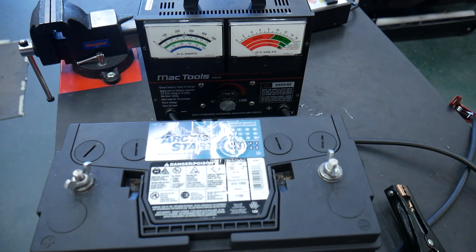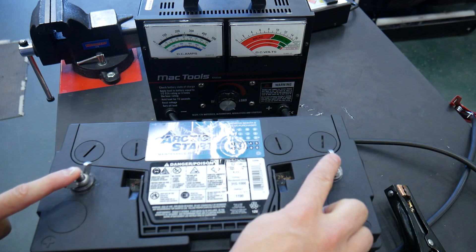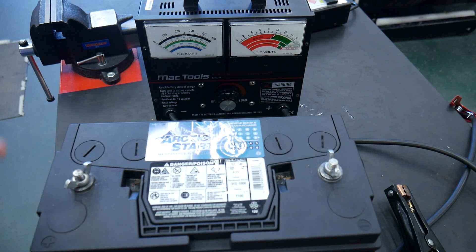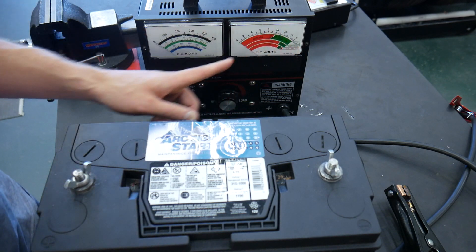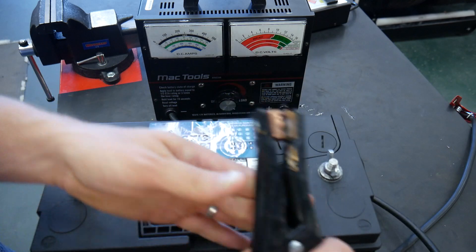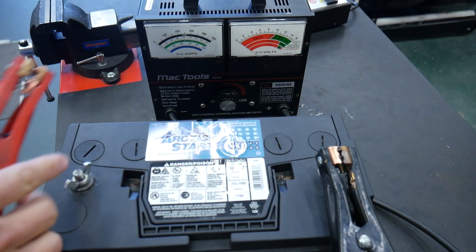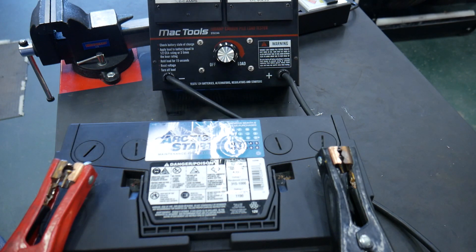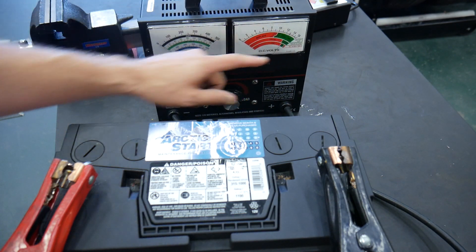Let's talk about doing a battery check. We're going to look at the voltage and check it with our multimeter. This one just came off the charger — it's 12.6 volts. We could also confirm with these analog gauges that come with the tools, though they aren't always the most accurate. We'll clip our positive and our negative and see where our battery voltage is. This one's in good shape — it's reading 12.5 volts on the gauge.